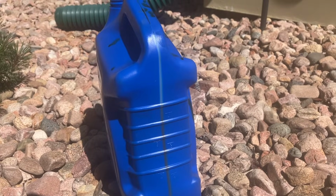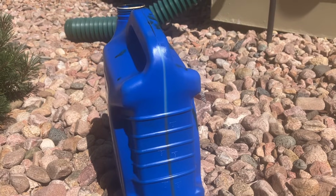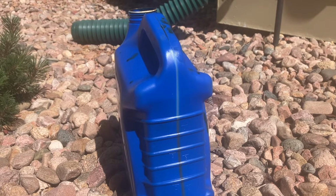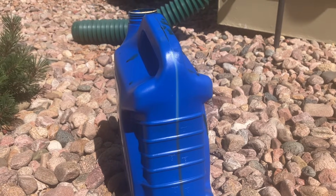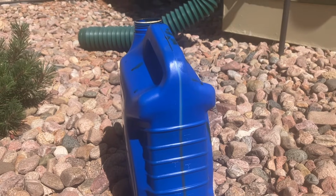But it's important to understand how much your vehicle burns off in between oil changes. That way, you can supplement that as you're going in between the oil change. You really don't want your engine operating at lower than 5.1 quarts if you have that 2.5 liter engine.